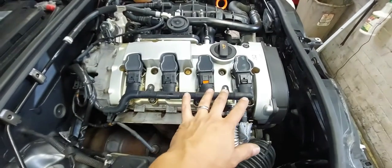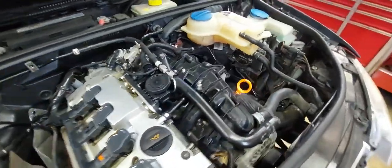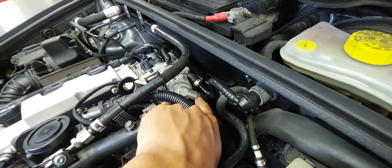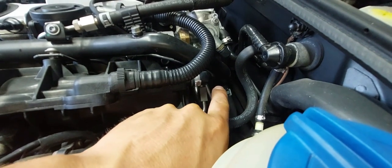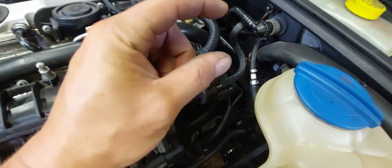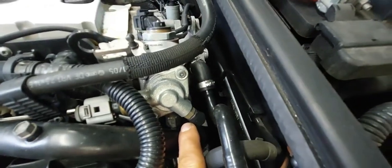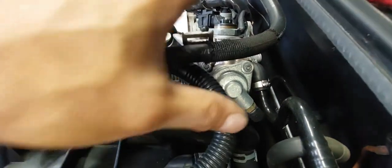So just a quick rundown: I'm going to remove the coils and the harness, all the electrical connections that are back here. We have to remove the high pressure fuel pump, which is relatively easy to get off. It's held on with three bolts, but you need to remove the pressure Schrader valve there. And then there's two lines underneath — one of them is a triple square banjo bolt, which is very tricky to get to. What I do is remove the coolant bottle and then snake it from under there with about a six inch plus three inch extension, depending on the size of your triple square sockets. The other one is a 17 millimeter flare nut. Both of those have to come out before you remove the three bolts for the high pressure fuel pump.